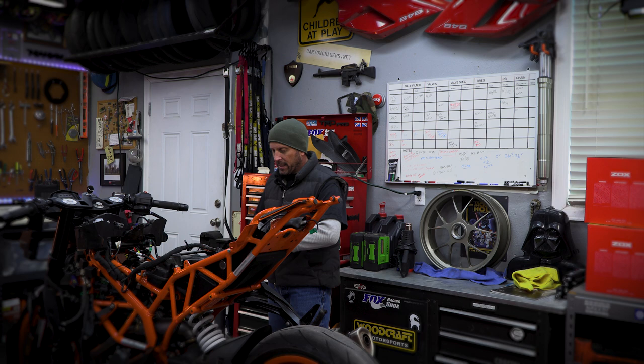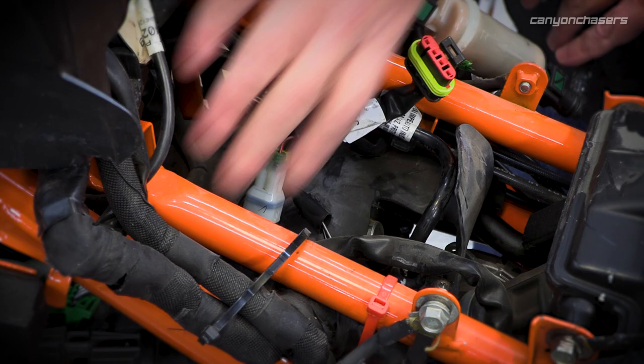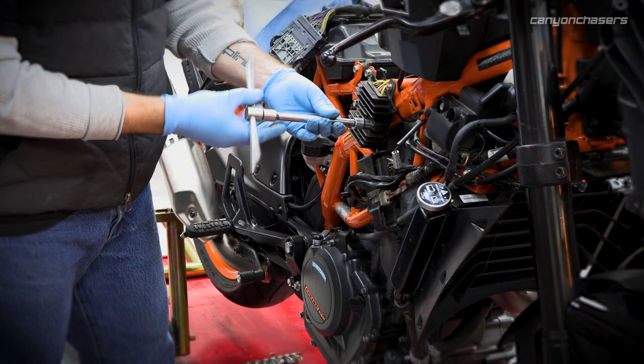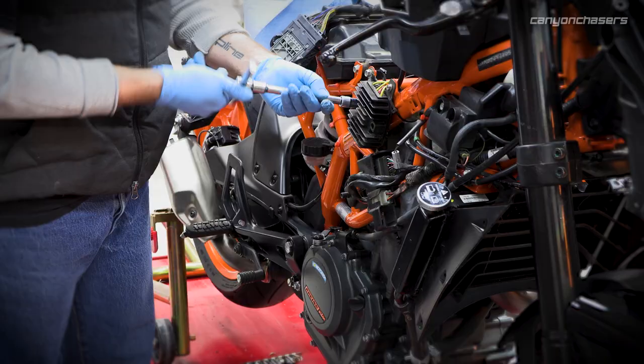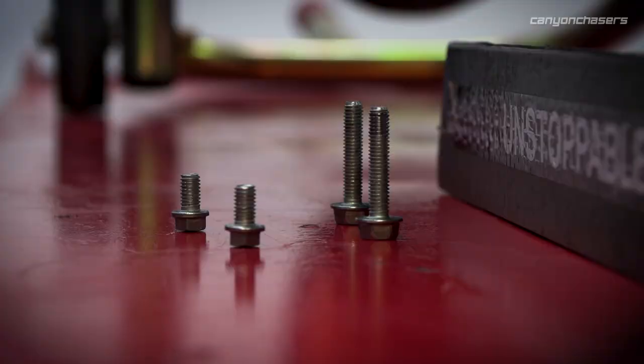I just got to figure out how to get to that valve cover — there just isn't a whole lot of room. I've got to get in between the frame rails here. There's the spark plug, the regulator rectifier. It doesn't seem like it gets a whole lot of air right here, and when you make a bike a track bike, because you don't have headlights running, the regulator rectifier has to work way harder and as a result they tend to fail at a higher frequency.